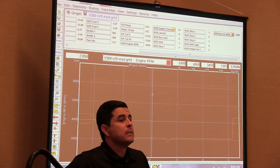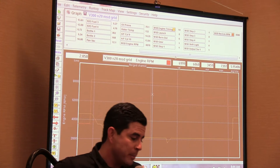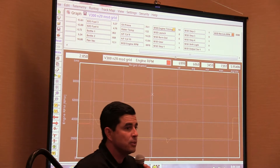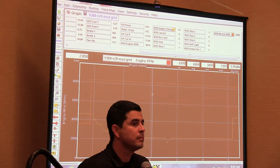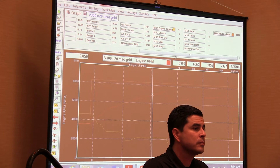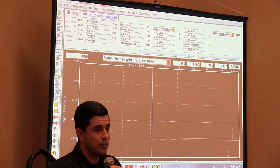What MSD do you have to integrate with that? The MSD Grid is a timing controller — that's what is able to stream data over to the RacePack. It can be used with the Grid ignition or any of the legacy other ignitions: the digital 7703s, MSD Pro Mag. That Grid timing controller can be used on 90% of their ignitions they currently have or had. So I need to buy something besides what I have? What do you have right now? The majority of the MSD Grids can adapt to the majority of the ignitions out there to control the timing.